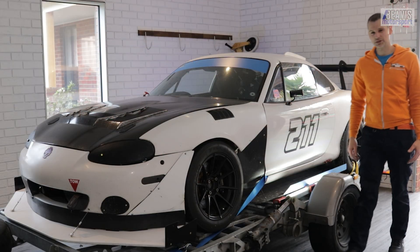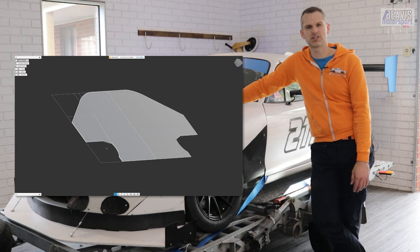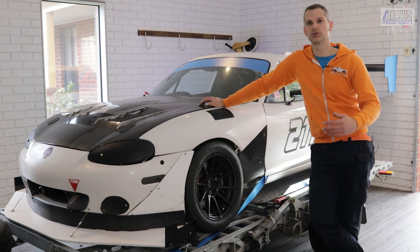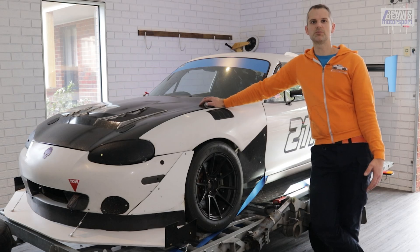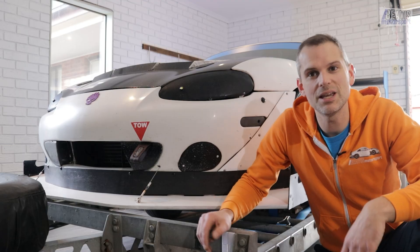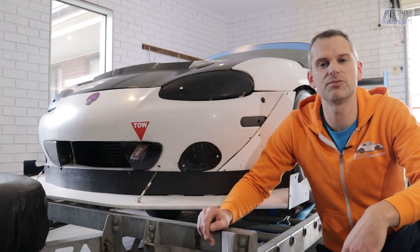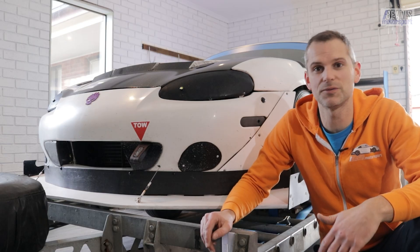The first step was to draw out rough measurements of the plan shape. I took the old splitter as reference and made this one very similar in size, although this is a slightly more refined shape. I then got to work with multiple layers of plywood, glued and screwed together — a plywood lasagna. The idea was simple: thickness equals strength and the layering helps keep it rigid and stable. Yes, there is a weight trade-off, and I'd be much happier if it was lighter — maybe some fancy carbon-wrapped foam board solution — but that'd cost more and I'd fear damaging it at its first track day.